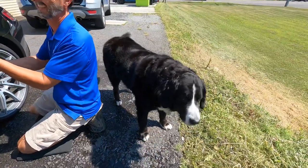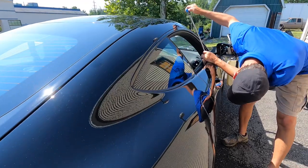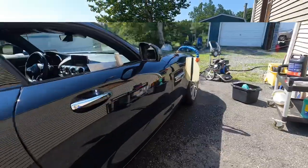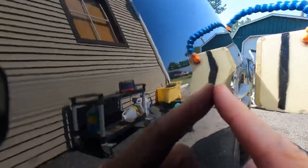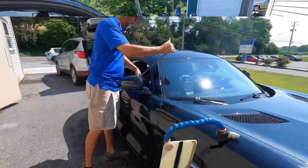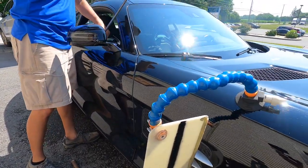It's funny, as you pull the dings out and make the panel flat, other ones will appear, as the larger ones draw your attention and sometimes you miss them, and that's exactly what happened right here. We straighten out the ding towards the handle itself, and another one appears. So we'll take care of it. That makes three total we have pulled out from the surface of this vehicle.